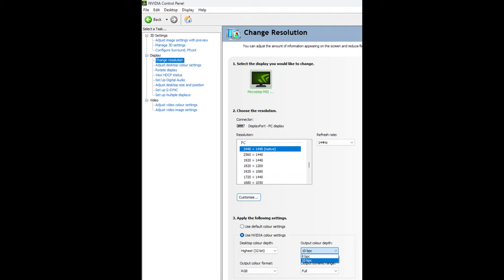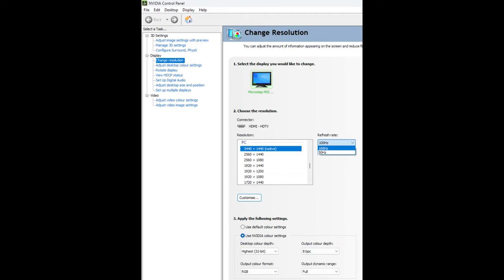If you're editing with 10 bits per channel, 144Hz is your maximum via DisplayPort. Via HDMI it's interesting — there's a 100Hz and 50Hz selectable but no 60Hz, which is a bit odd. You can use HDR and AMD FreeSync VRR over HDMI, but as an Nvidia user or if you're using a PS5, there's no HDMI 2.1 VRR support. At 50Hz you can select 10 or even 12 bits per channel, though obviously 50Hz is very limiting. There is also a 4K UHD downsampling mode accepting a 4K signal at up to 60Hz, useful for games consoles.